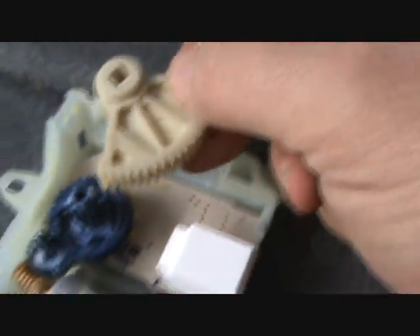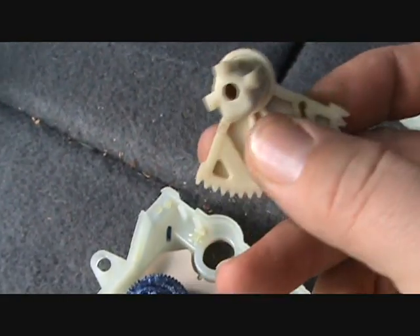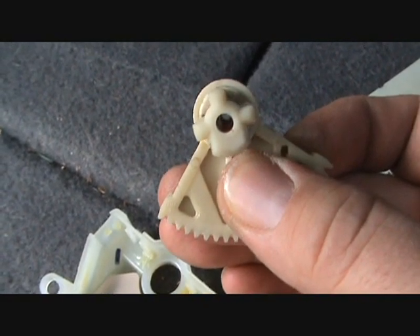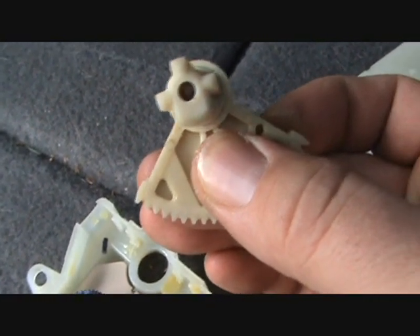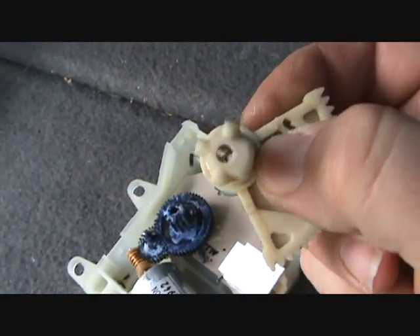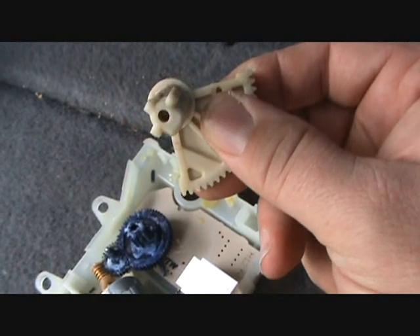This piece goes over here — you've got your little reduction gears, and they have different shapes. Some of them are a cross shape, and some of them are D-shaped. So you have to take this box out to figure out what kind of keyway you need so you can order the right replacement. The last thing you want to do is order a D-shaped one if yours is a cross, and vice versa.